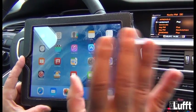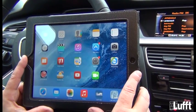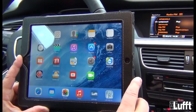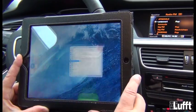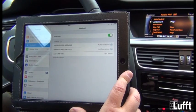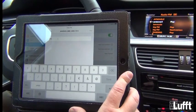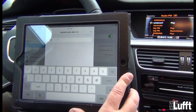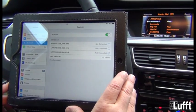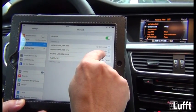Now we want to connect the installed MARVIS on the car with the iPad app. The first step is to pair the MARVIS via Bluetooth to the iPad. This will be done under the general settings — open the general settings and go to the Bluetooth configuration menu. Normally the MARVIS will be detected automatically. You have to enter the PIN, which is 1007, then click done. The MARVIS should now be paired and you will see it shows as connected.